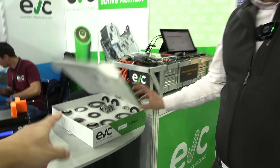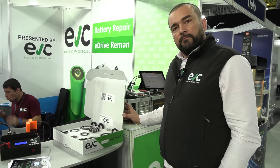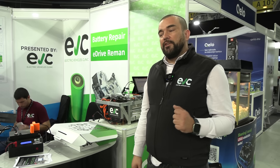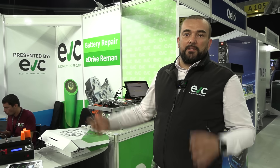Quick question about this set: which Tesla do you recommend they get it for — 2014 or which models? Almost all with the large drive unit — rear wheel drive or even P85D, P90D, P100D, also the X. They have the big large drive unit in the rear, and they will need this kit to be successfully repaired for endurance, to make high mileage. It's almost from 2013 till 2021, because even the Raven P100D has the large drive unit in the back. Tesla used the same drive unit for a pretty long time frame.